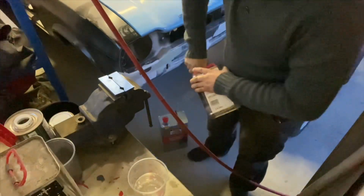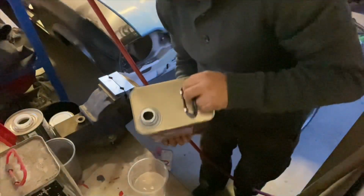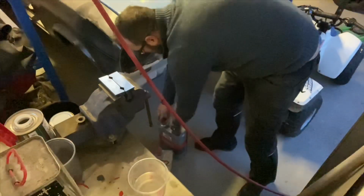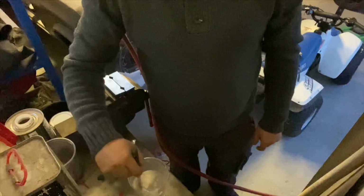and between 10 and 20% thinners. There's 15 in there. So that's it, as simple as that. First coat we're going to do is what people call a gripper, which is a light coat. Basically it's a tack coat for the second coat to cling to. So I'll get this mixed up and I'll come back to you after we've actually got it on the bumper.